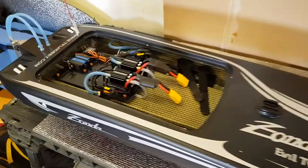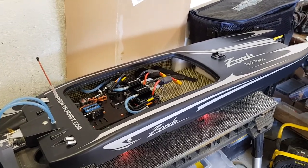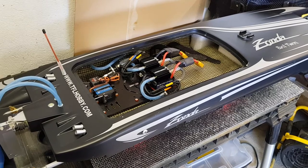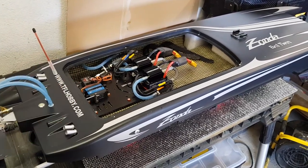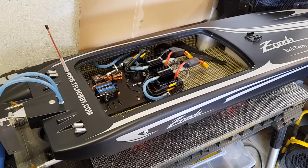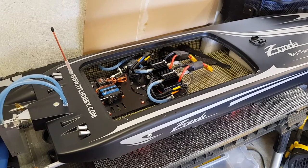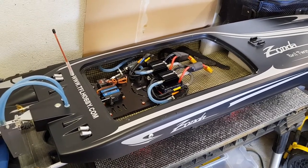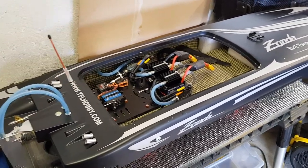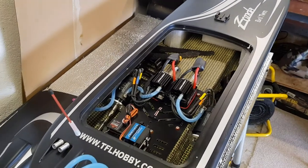You have to go over these things. This is not something you can simply stick your radio gear in and go. You need to check everything. When this arrived, you need to put in your radio gear, put in your servo. But also, the water hookup was completely blocked on one side — they put the triangular splitter on the wrong way. Luckily I was only running 3S on each side with the 120 amp ESCs before I realized that, so temperatures weren't too high. Check that the cooling system is working by putting the pipe in your mouth, covering the end, and blowing down it. I also worked out that this motor jacket leaked, which I fixed with a bit of grease and working the seals.